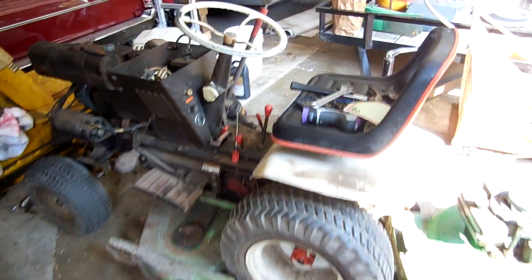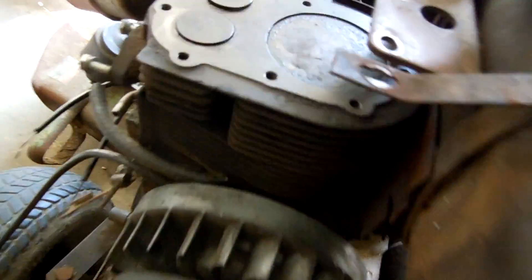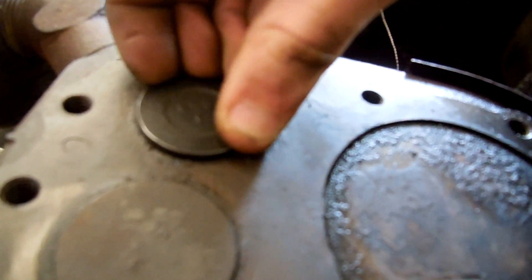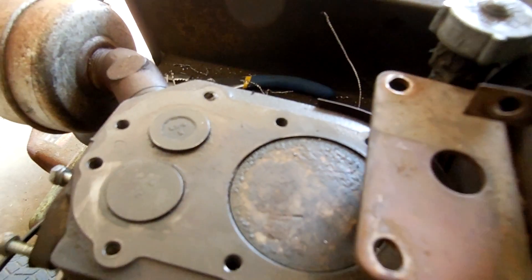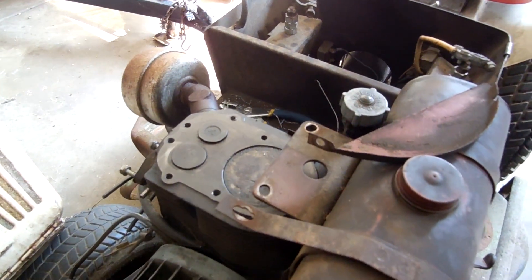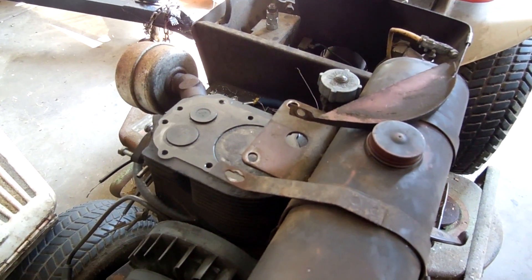And then also came a 1965 Bolens 1000. There's a Wisconsin TR-10D engine, which is in pieces right now because I'm having issues. You can see that this would be the compression stroke right now and that valve is still turning. I know the compression release is functioning right now, but the oil was so sludgy in here, I'm thinking the compression release is stuck on. It'll only run for a little bit — once it heats up, the valve opens more and more and it eventually dies.